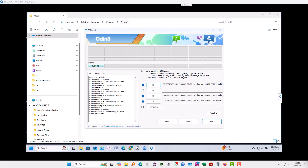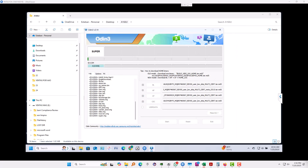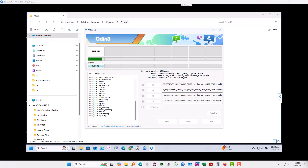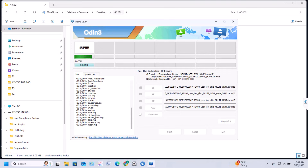The file is now flashing and you should see a progress bar on the phone, indicating it is receiving the Android 15 firmware update. Once complete you should see 'Success' in Odin. After that, go through the device setup and skip Wi-Fi — just tap Next through the setup without connecting to Wi-Fi and the phone will be completely unlocked.